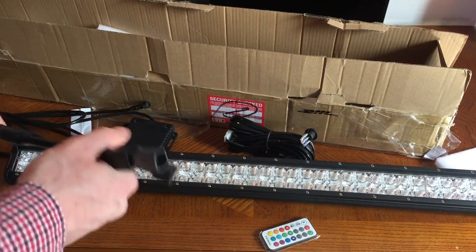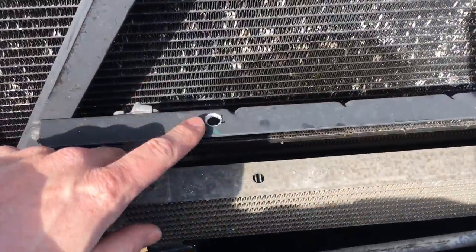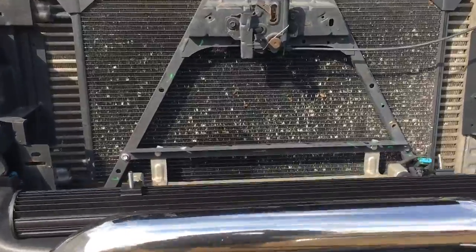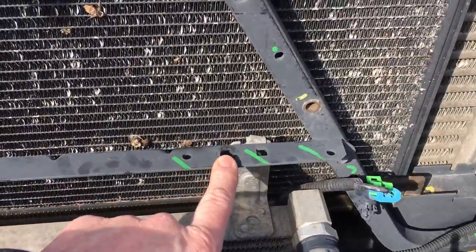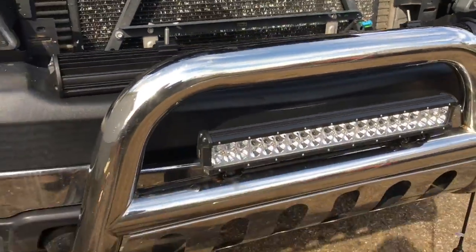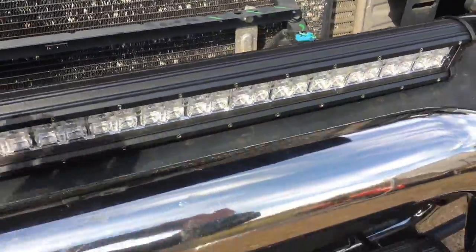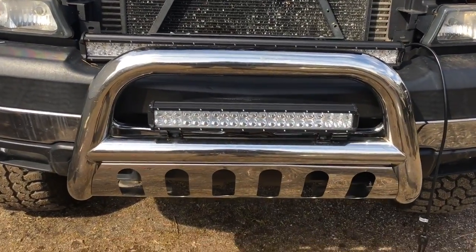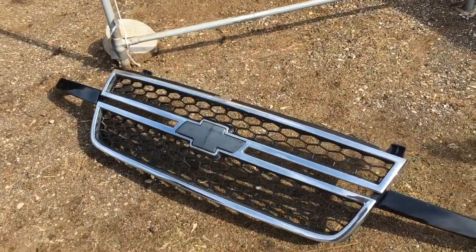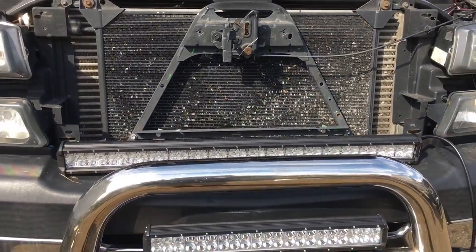I'm going to mount this right here. What I did is I went ahead and drilled one hole. If you have a Chevy Silverado like mine, you're going to have this A-frame right there that holds up the hood latch. I'm going to mount it right here on this base. There will be a wiring harness attached right here, and I'll use this existing hole. I also have another light bar here that I'll be taking off, since once this 34-inch is mounted, the top of the bull bar might affect the light. Taking off the grill is pretty simple — it just unclips, no bolts — but you will have to take off the top shroud.